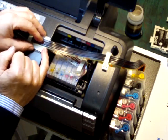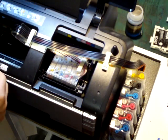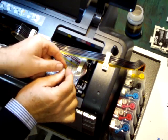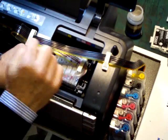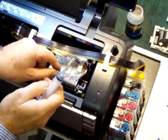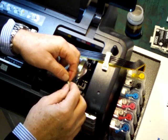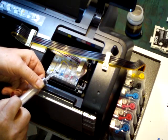All we do in this case is disconnect this tube and we can see what our problem is. As soon as we disconnect this tube, you can see these bubbles going back down the line, which indicates the bubbles are travelling down. In the case of this sort of problem where you see bubbles coming up, you can actually pull the inks back up the line quite nicely.